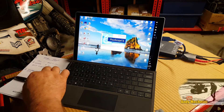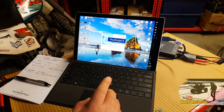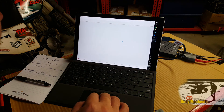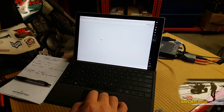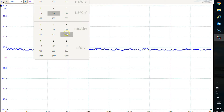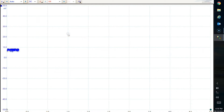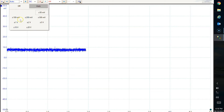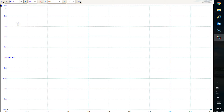We're going to have some parameters to set because we're using both lines — two lots of parameters to make sure are set properly. Time base: let's use 500 millisecond divisions. Now line one is the amperage — that's the blue line — and we're going to use plus or minus one volt, which gives us basically plus or minus 10 amps, and it shouldn't use any more than that. DC.